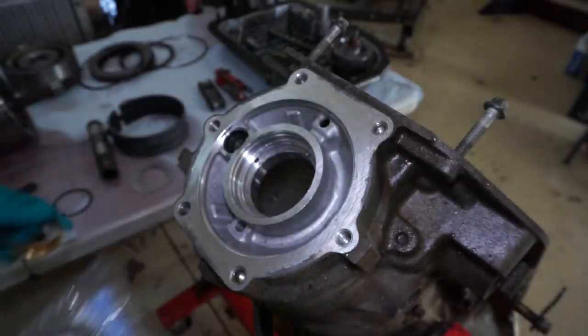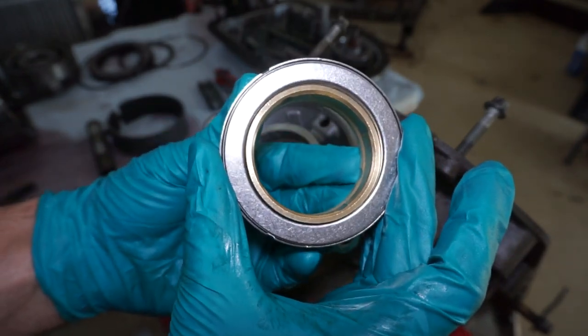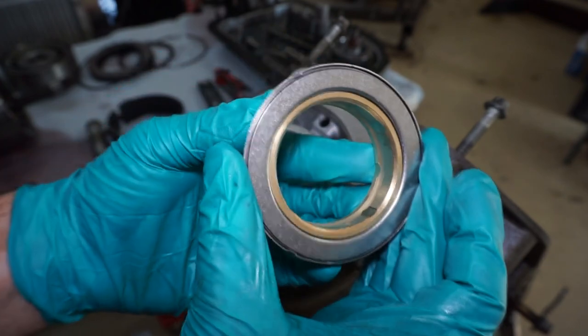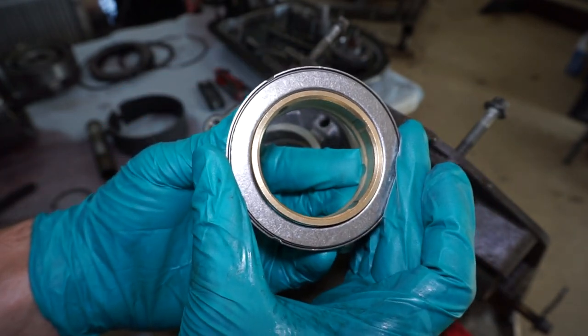The anti-walkout bushing and bearing kit has to be pounded in from the inside of the case. This kit is set up with the correct bushing, bearings, and shims so you don't have to worry about any of that. You can do it correctly from the inside — your anti-walkout has this big lip on it that gets pounded in from the inside of the case so it can't wiggle itself and fall out the back. It also comes with some shims of different sizes, and a bearing that fits right around the outside of this bushing. You can pound the bushing in all the way and then the bearing goes right around the outside.